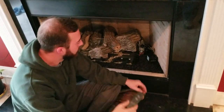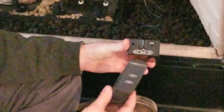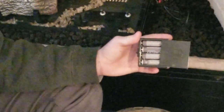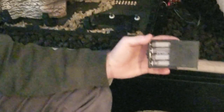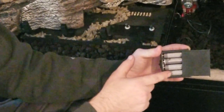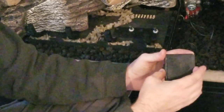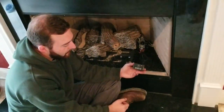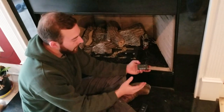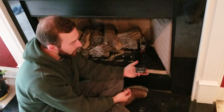Here's your remote on and off. Really simple. This is your remote box, conjoined with your remote. This has four AA batteries in it. They need to be changed out once a year — it's imperative. If you do not, you run the risk of these getting low and starting to leak. Once they start to leak, this box is no longer good. This box also acts as a switch, so if your remote goes out or the wall switch quits working, this can also be flipped to the right to be used as a normal switch.